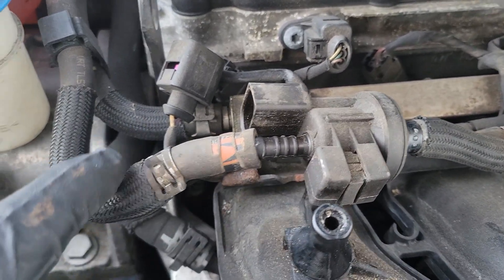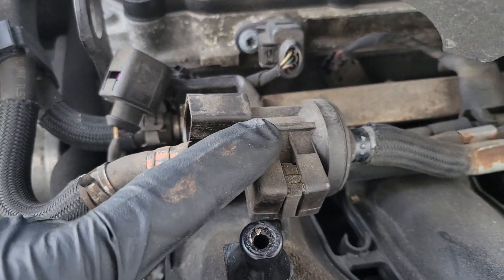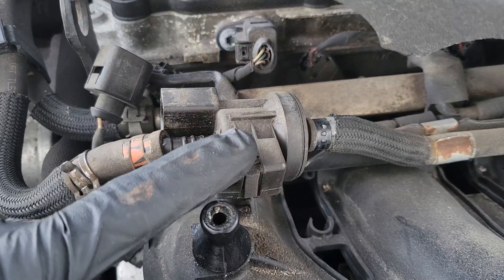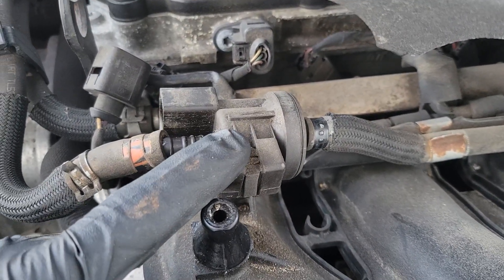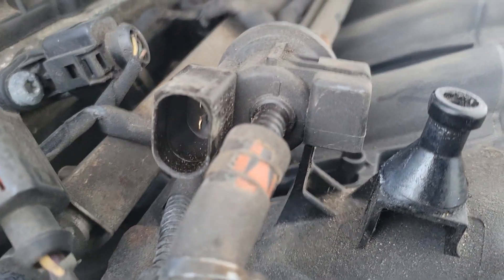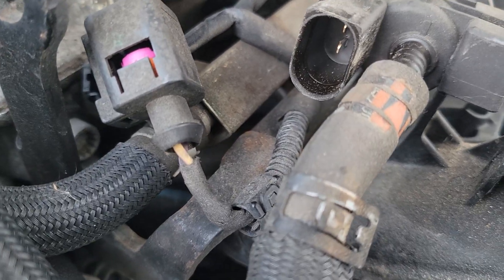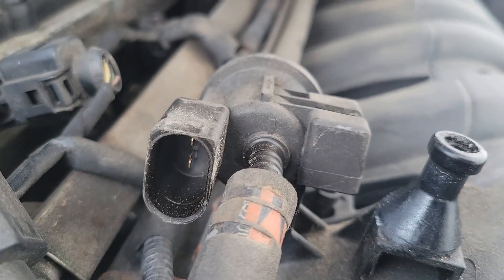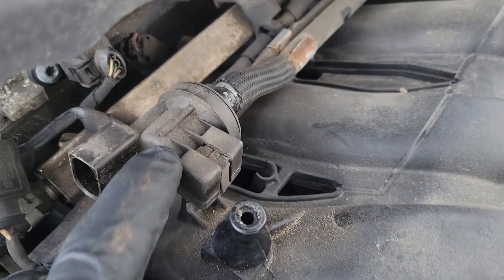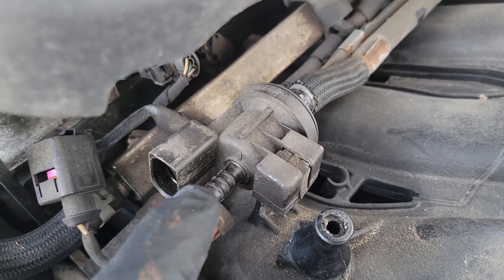Your leaks could be from the lines in the system or the gas cap as mentioned, but on this platform this valve can actually not be sealing properly and cause a leak. Traditionally when this valve goes bad you'll have a code for EVAP purge during a non-purge event, but with this vehicle sometimes you don't have that monitoring. One way to test this valve is to apply power and ground to the solenoid — always make sure it's disconnected so you don't back-feed power into the ECU. Get some alligator clips in there, power it up, and you should hear it click and have pass-through through the valve. With it unplugged or the vehicle off, this valve should be sealed — you shouldn't be able to draw through it at all.